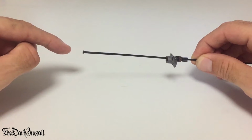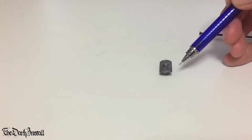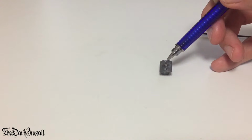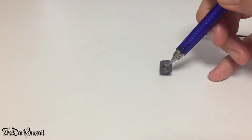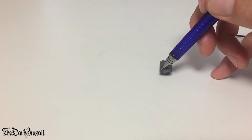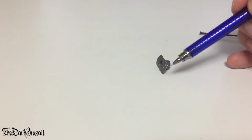So starting from the rim side then, this is a standard straight pull spoke head. Now this interesting piece forms half of the nipple system in the rim. You'll notice this piece is angled over to one side because each nipple system is either for the left side of the rim or the right side of the rim. Now, whichever side it's supposed to be for, it will be further to that side, which means that this side has to be angled further down than the other side. It's threaded inside, and this is held onto the rim with the carbon laminate.